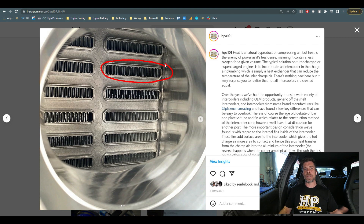Because it was that generic 600 by 300 size, we swapped — with this particular car still bolted to my dyno — with one that we had in stock that had a proper internal fin design. I can't remember specifically, but I think at the same boost pressure we picked up something in the region of about 40 or 45 kilowatts at the wheels. It was a massive improvement for just changing the intercooler.